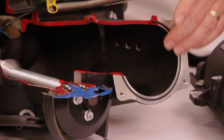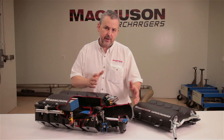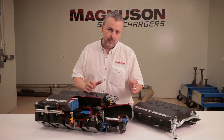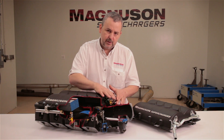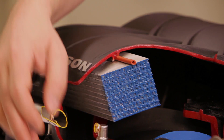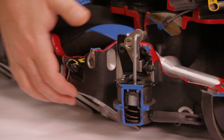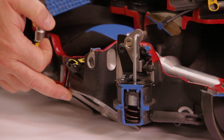To ensure we satisfied the brief of making it easy for installers, we went to the extreme of putting O-rings on every interface and dovetailing the O-rings in there so that during install they can't fall out. You no longer have to look around underneath your car to see what O-ring you dropped at the end of the install — it's never going to come out. But if you do ever need to replace it, you can hook it out, and they are standard off-the-shelf O-rings. Those O-rings are used right through the system, along with silicone seals on the charge coolers. The manifold-to-head interface uses the standard LSA gasket, which has little retainers to hold it in place as you're putting the supercharger down — so it doesn't slide out of the way, you can't get it wrong.